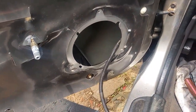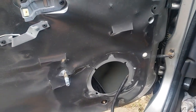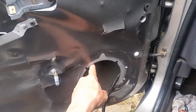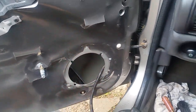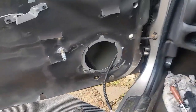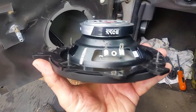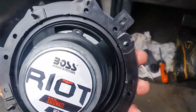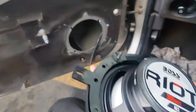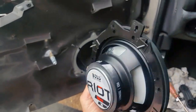To put my speakers in on my Neon I had to do a little modification — you can go back and look at my other videos for details on that. The problem with the Neons is they have these big center holes, about seven inches wide, so a lot of times a speaker will not bolt straight in. You have to use adapter plates. You can see my adapter plate bolted on there. They give you those little retaining clips, and I opened one up a bit to make it work. On the back of the speaker is their logo and it says 300 watts.